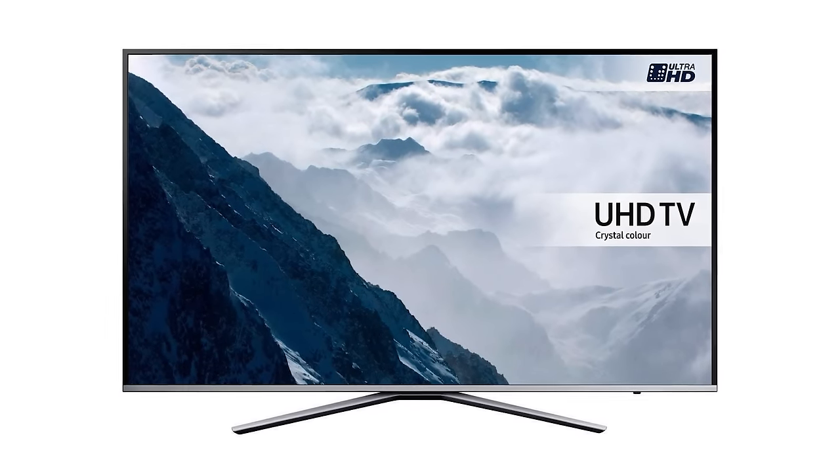That applies across all 2016 Samsungs including the lower-end KU series. We previously reviewed the KU6400, and a lot of these lower-range screens suggest they support HDR but they've only got 8-bit panels. They accept the signal but they aren't actually displaying it properly — it's a truncated version of HDR. Other issues include lack of wider color gamut on many lower-end models, and no dynamic backlight — so if you ramp the backlight to maximum during a nighttime scene it becomes completely washed out, ruining the blacks. You're getting brighter highlights but not much else.